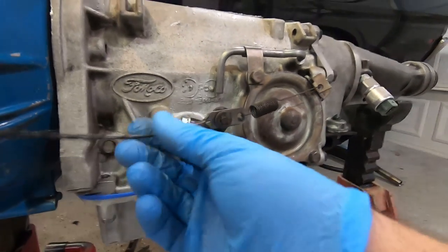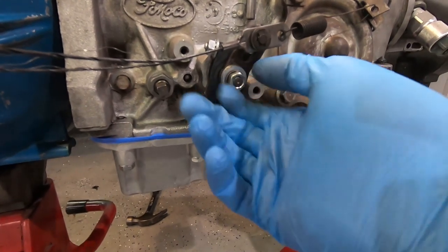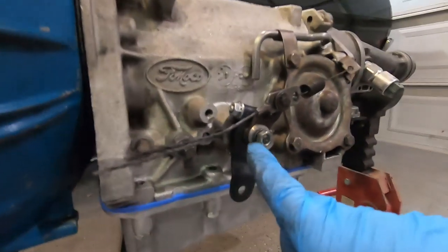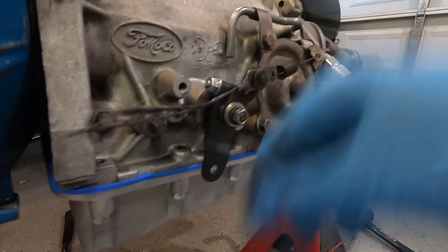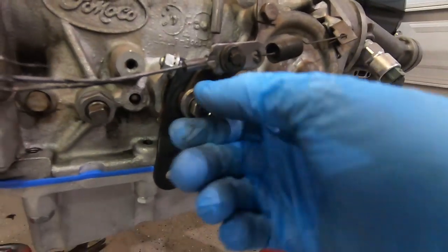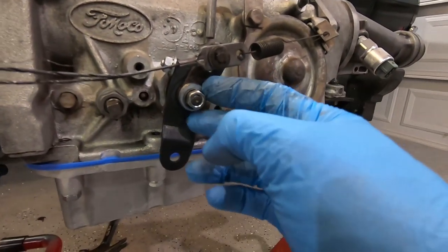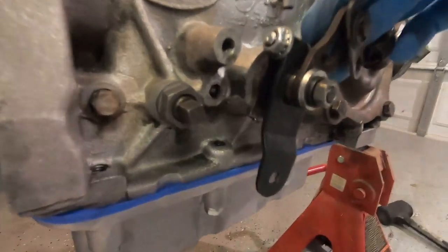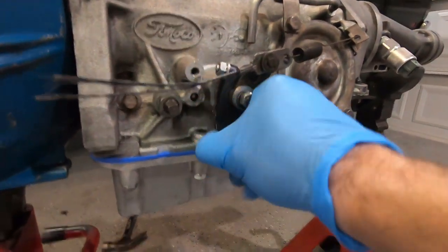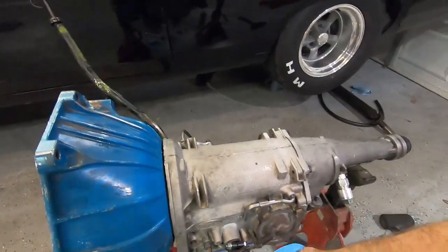Another thing — the kickdown linkage is clearly broken. Someone had a mismatched bolt on here causing a lot of slop and play in the kickdown. There's also a seal behind the kickdown linkage rod between your shift lever and the kickdown rod — that had so much slop in it, which was another area for leaking. I went ahead and found the correct bolt, put a lock nut on it and a bigger, thicker washer, and got it nice and tight. So the kickdown works once we get our cable replaced — that was another leak spot hopefully resolved.